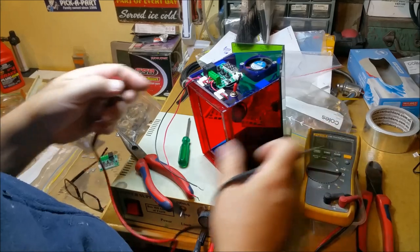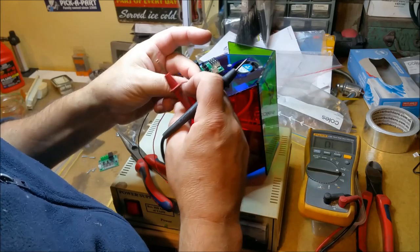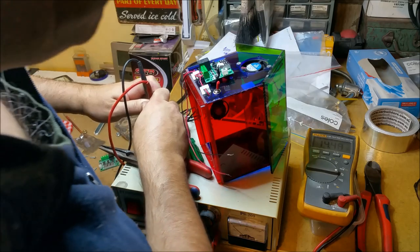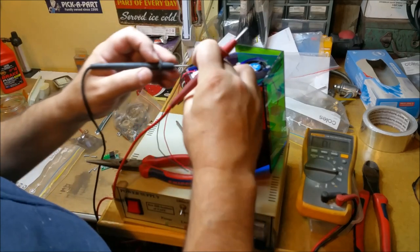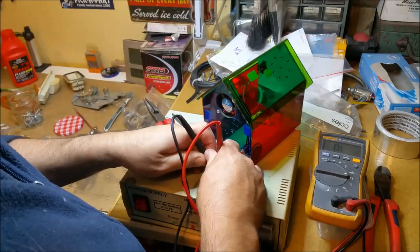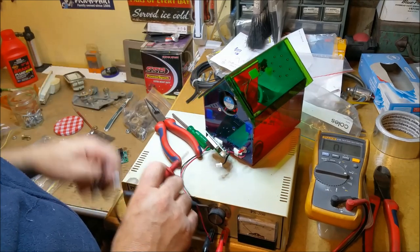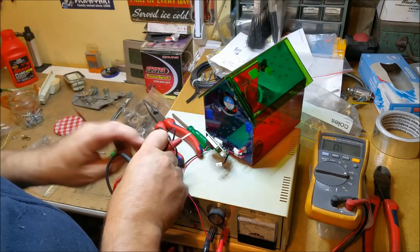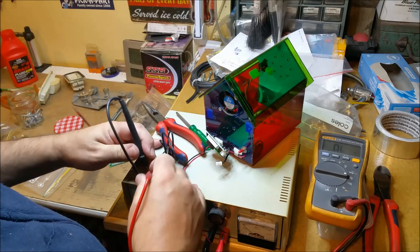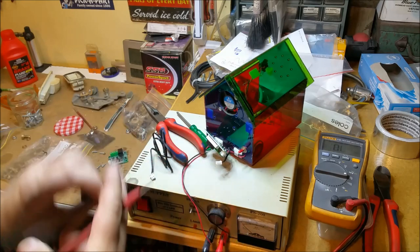I've got an ohm meter, a multimeter. I just want to see what the resistance on the thermistor is. If I can get to... Oh, there it is. 14 kilo-ohms. What's this one say? It's at the same temperature, so it should be reasonably similar. 14 kilo-ohms. 14.3. I'll just double check this again. Should be 14.3. I'm pretty sure it was. And if that's the case, this guy goes back to good and it's all fixed. I just have to change a $2 module. Oh, 14.2, yeah, that's fine.